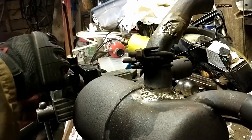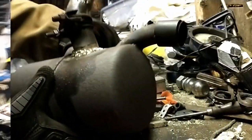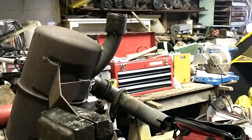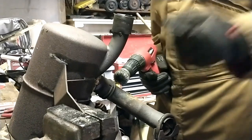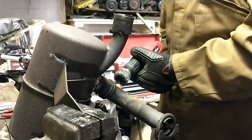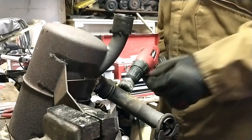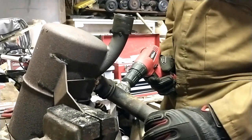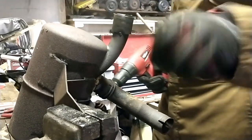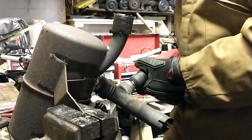See if we can get this set over here. Cool by now. Dad wore a hole in this pipe. It's my secondary. It's got a shaft that runs to the front of the chassis that holds the secondary forward. The part where it attaches to the frame broke off, and the secondary just flew forward, and as it was running, it wore a hole right in my exhaust.